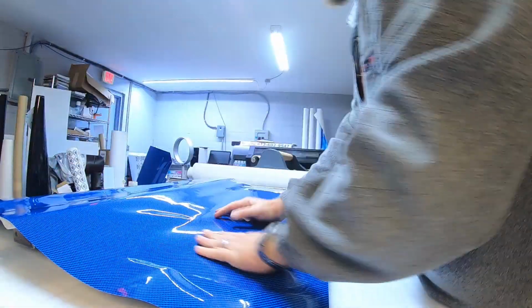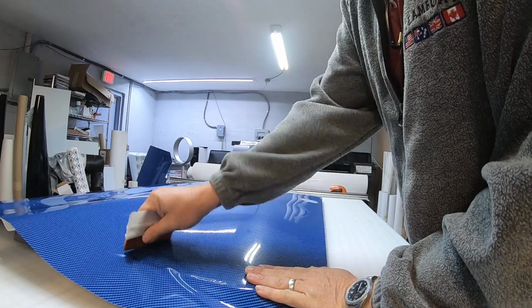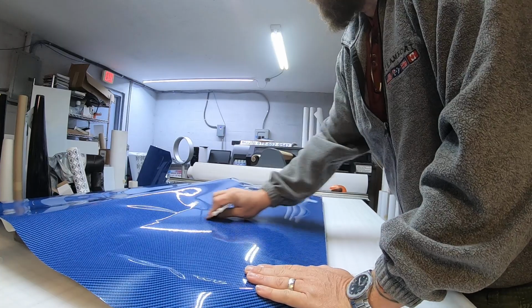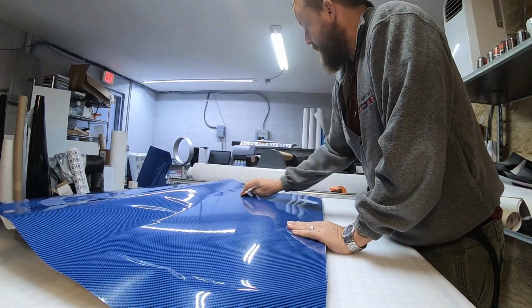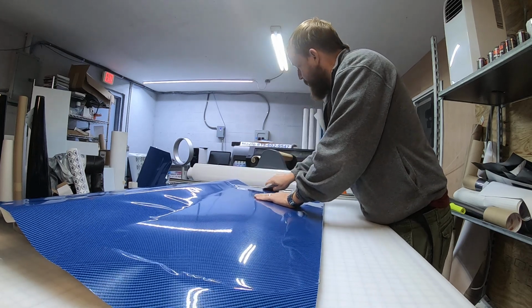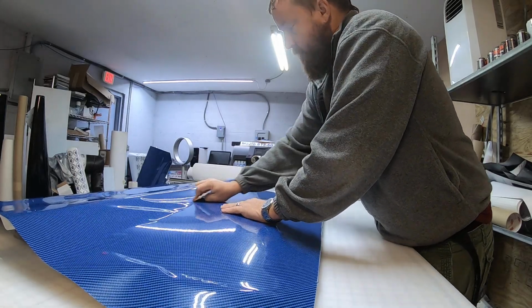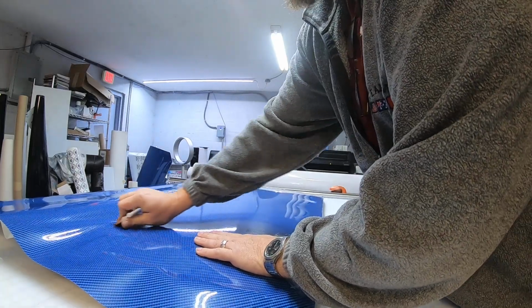without the high expense and long downtime, because we can wrap a hood on a vehicle within about an hour and you can be back out on the street and running. Whereas with a paint job, you're probably going to be without that truck, or at least that part of the truck, for a couple days while they bake the paint so that it cures thoroughly enough to go on the road without damage to the paint.